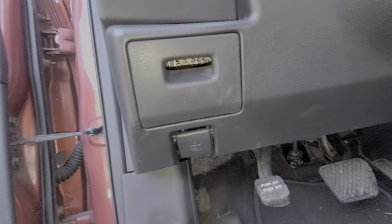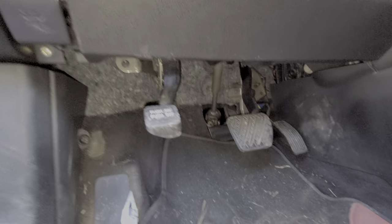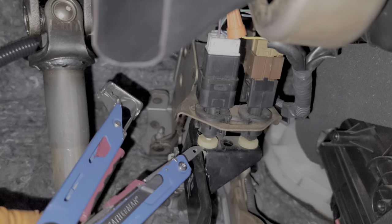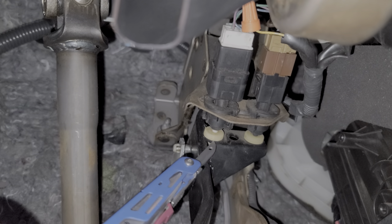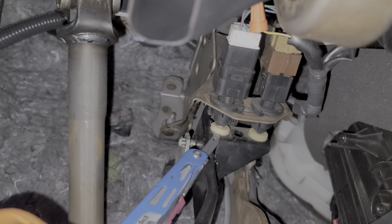Now let's take a look at the stoplight switch — I'll show you how to change it. There's also a common issue that can result in your brake lights being stuck on. If your Nissan Rogue always has the brake lights on, you'll want to check to see if any of these grommets are missing. These grommets are kind of rubberized plastic and over time they can disintegrate and fall out. When that happens, the brake light switch will think that you're always hitting the brakes, so the brakes will just be stuck on.